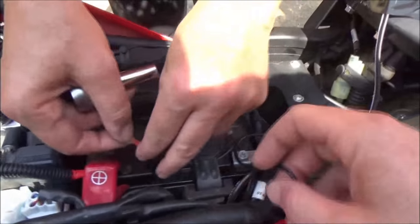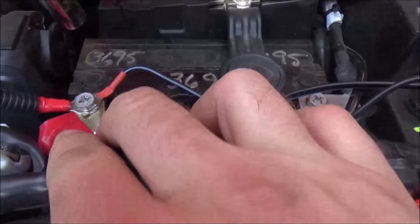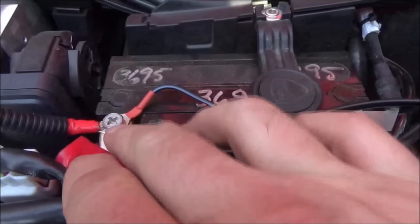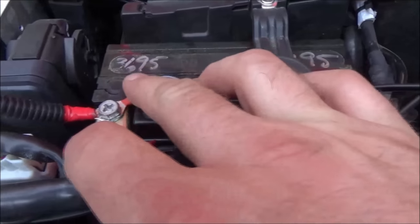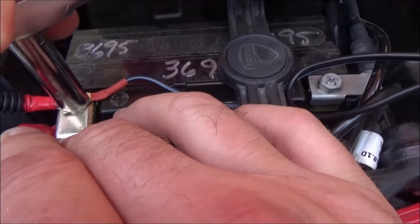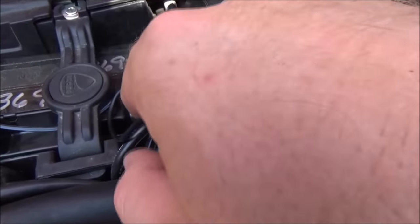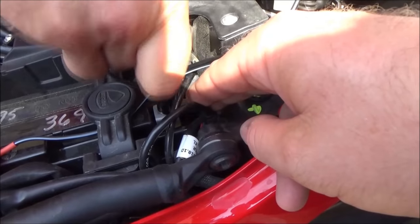We're routing the wire this way underneath, remembering that the seat above could make contact with those wires, so we're doing everything we can to avoid that. We'll slide the fork in — once cracked loose, as we tighten it the terminal will move with the fastener and we want it to land in the correct tight position. Watch as she tightens it — it lands right where it should. Check cables, make sure nothing's loose. Now repeat the process on the negative, and this will also fix that missing washer we mentioned earlier.